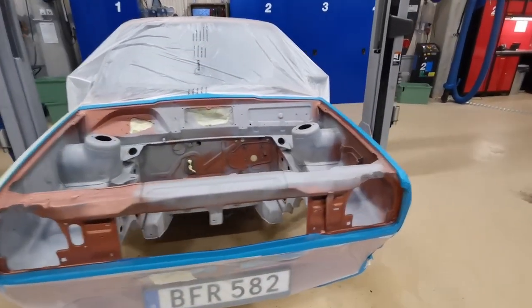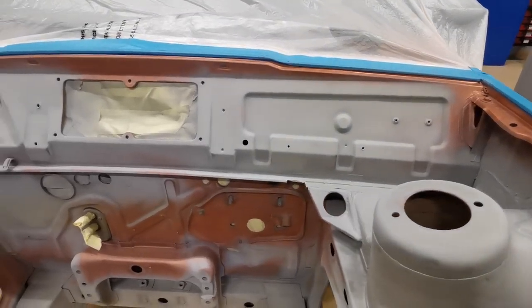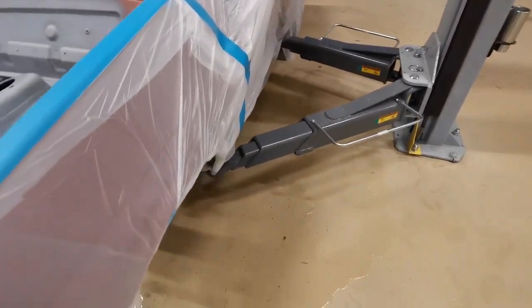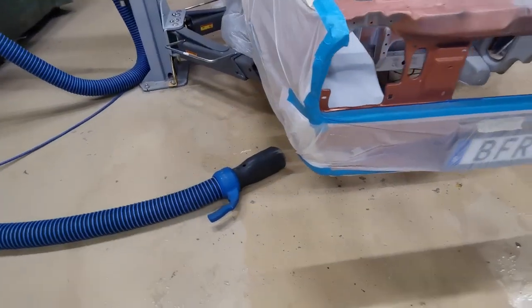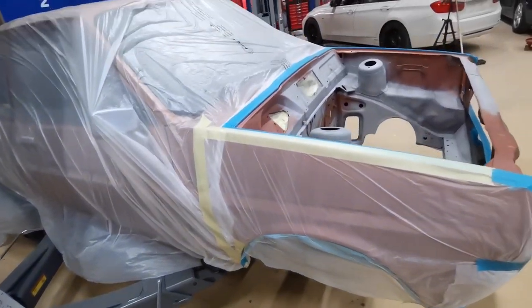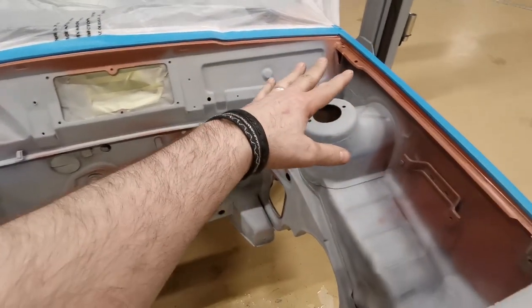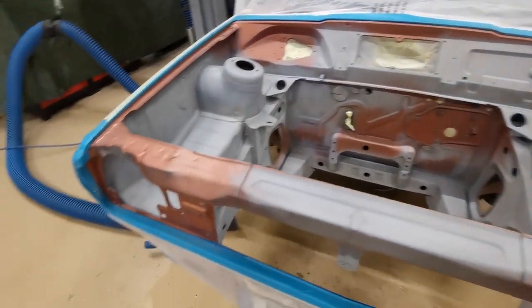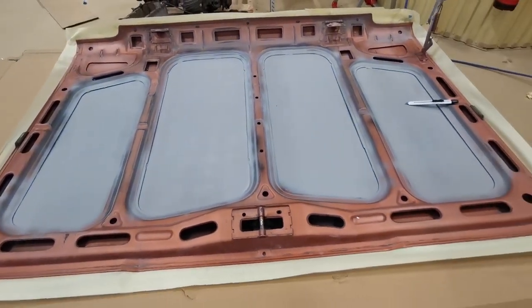That's the car all masked off now — totally covered up everywhere we need to be. Primer on anywhere that wasn't covered by the original paint, and all the holes filled in, ready to go. We've got a hose running with some water on the floor to collect the dust, and the extraction fans are ready with some filter across that. We'll start off by painting the top side of the car, across the tops and the front, then lift it up and do all the rest of the underneath. We're hoping we've got enough paint to do the bonnet too; if not, that can be done at a later stage.